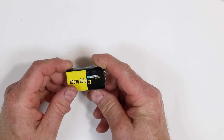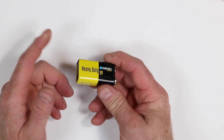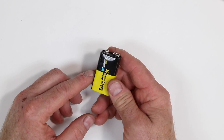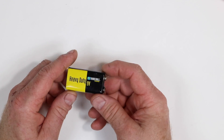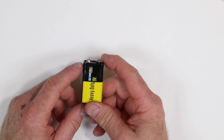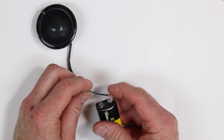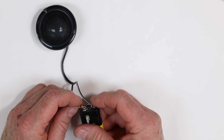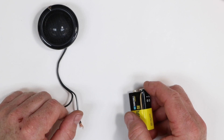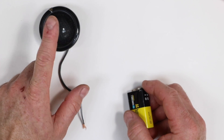First thing you're going to need is one of these — a 9-volt battery. For most things in life this is pretty archaic and you don't use it anymore, but for 12-volt work it's a very handy thing to have. It basically powers every voltmeter on the planet. It also makes a great speaker tester because it's enough voltage but a really low amperage to move a speaker, and in this case that's what we want. When you have a tweeter and you hook it up to the battery, it's going to make a sound — which is fine. That means that this tweeter has no form of bass blockage or crossover on it. It's basically two wires soldered onto the tweeter and you're hearing the diaphragm move.